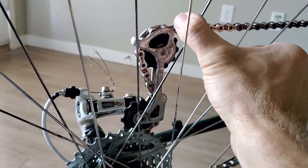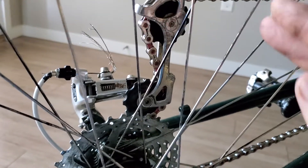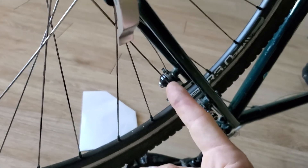So we want to loosen and then tighten if you think the drive side is tight enough. Squeeze there — if they don't really move, it's tight enough. If it's got a lot of slack, then we will just tighten the side that needs pulled and leave the other side alone. Then do your standard 1-2-3 knockout. The one was to check your dish — we just did that.